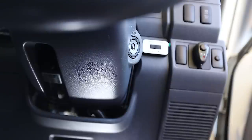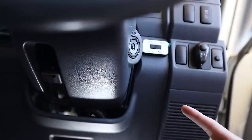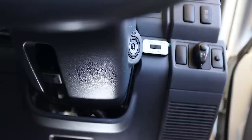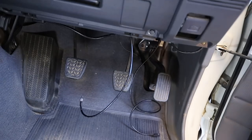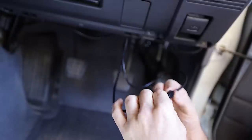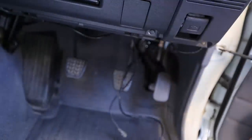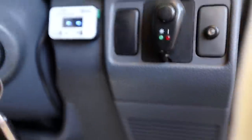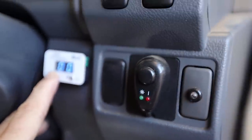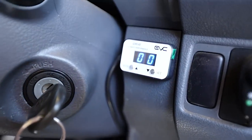The programming you have to do with this one is you've got to tell it if you have automatic or manual transmission. To do that, all you do is hold down the mode button for three seconds and it will either have double zero or double eight come up on the display. For manual it is double zero, so that's what I need to get it onto. The last step is to connect the control — make sure the nip's in the right side, that's how you tell which way it's going. Now it's ready to be turned on. I hold down mode and it is already set to double zero, so that's fine.